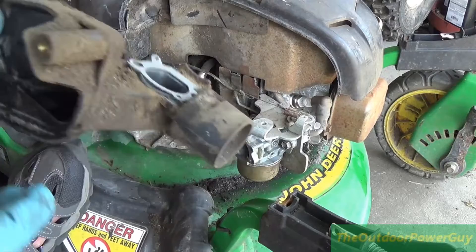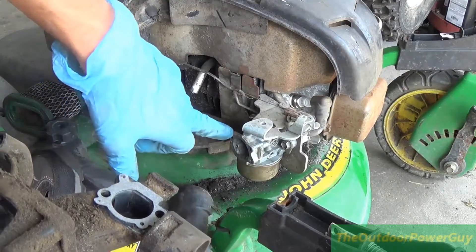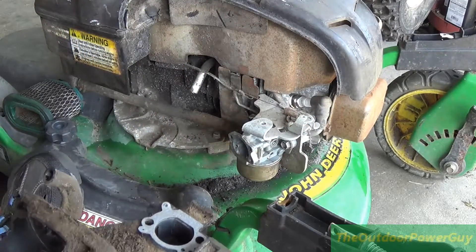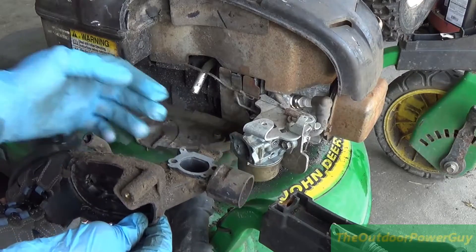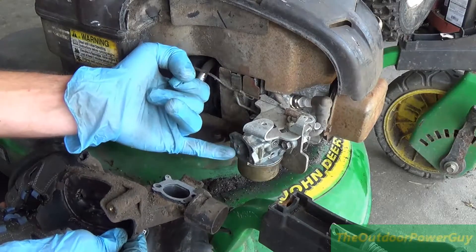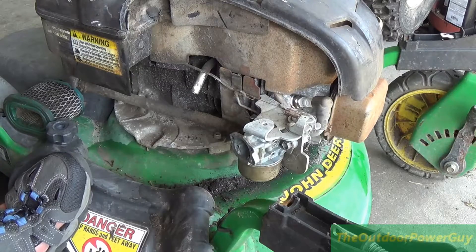Alright friends, this here is the air box. You have this little gasket behind it — that is a brand new one, by the way. I will put the part number to these gaskets down below. This is where the air box fastens onto. If this gasket is ripped, busted, torn, or missing, it will not prime and it will not run. This makes a seal between the air box and the carburetor so that only air coming in from the top of the air box can go in. If air is bypassing this, it is going to mess up a primer bulb and it is not going to prime. It is also going to bypass air straight into the carburetor and it is not going to run. Without that gasket, it will not run at all.